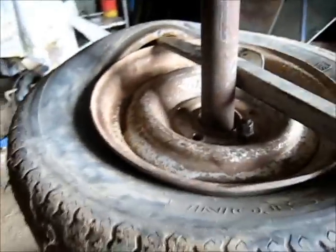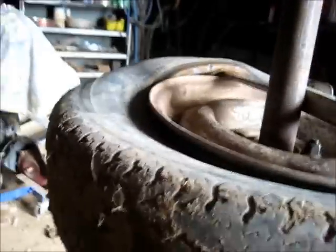I'll show you how I move these tyres. It's a bit difficult — I don't want to trash the inner tube because I might want to use it as a replacement for emergency use. Basically how it works is you try and just tap that tube down with the screwdriver without tearing it. You wedge the tool in, push the tyre into the second part of the rim, wedge it right in and lift up. That little blade there will just slide up and move the tyre off.